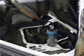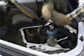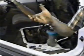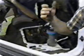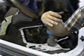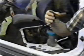Your distributor has to change when you cut off your petrol. If you run petrol by itself, you set at your normal, whatever it is, 8 degrees or whatever. If you hook up to petrol and gas, instead of 8, you would come up to about 12 to 15. When you cut out petrol altogether, you would come from 15 up to somewhere about 25 to 30, maybe more, depends on the vehicle. Whatever vehicle, it is all different, but you have to come straight around to that.